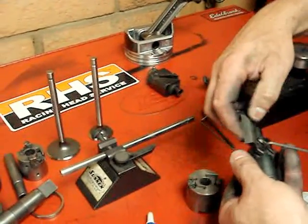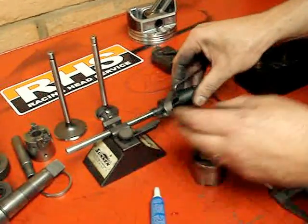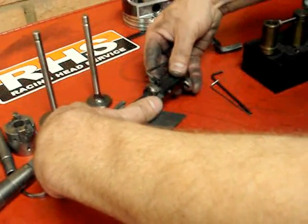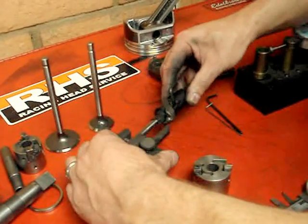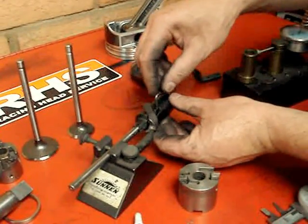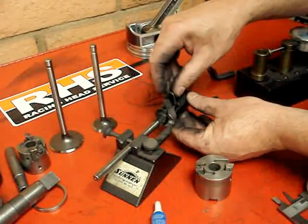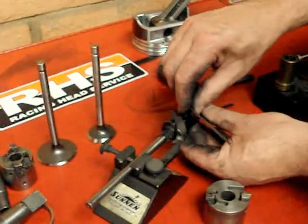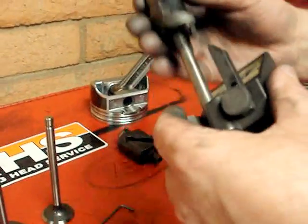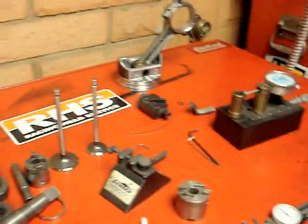They're already built into that. So we're going to take our seat cutter, install it, and then put our seat cutter back onto our pilot. We're going to come right up and put our 45-degree angle on this seat cutter right at this pointer. Once I get that set, we're going to lock it in place. Now I know exactly where my valve is going to contact that seat, and I'm basically duplicating that on my cutter. I double-checked that I'm on my 45, and I am. Now we take our cutter body, our spring, and our pilot.